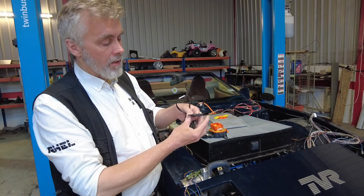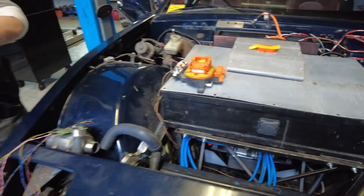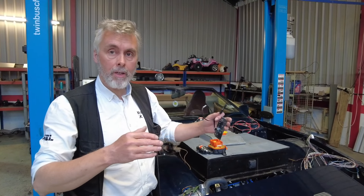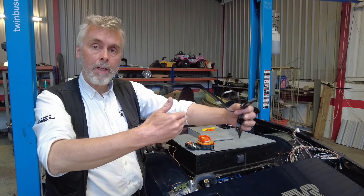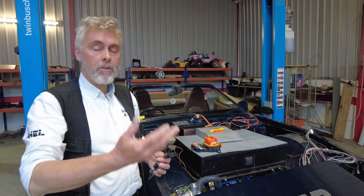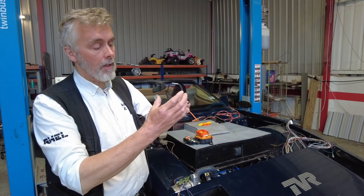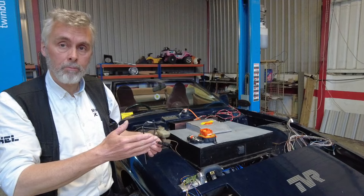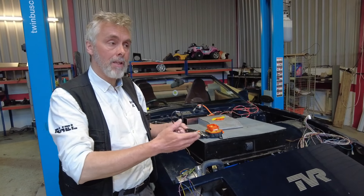The other thing this has got in it is a G sensor. These will get bolted to the top of the battery box inside. The G sensor allows us to work out whether the vehicle's been in an accident. The scenario we're always thinking about is what happens if you get caught in a multiple car pile-up — no fault of your own, someone behind you smashes into the back, you're knocked unconscious, ignition's still on, and emergency services come to cut you out not knowing your vehicle's electric. By having a G sensor in there, we can set a trigger limit where we know that means you've crashed. If it detects that, we go through a safe vehicle shutdown procedure. Within about 10 seconds, all of the orange cables are isolated, so anyone attending that accident is attending an isolated vehicle.